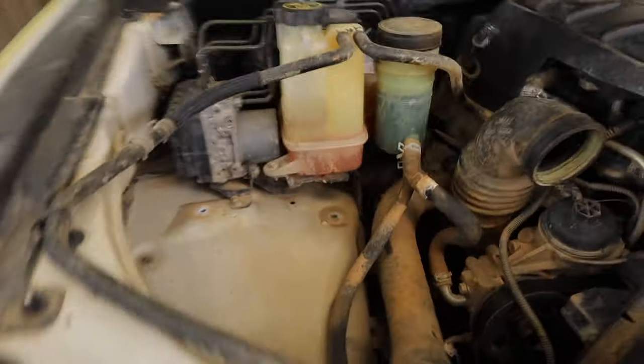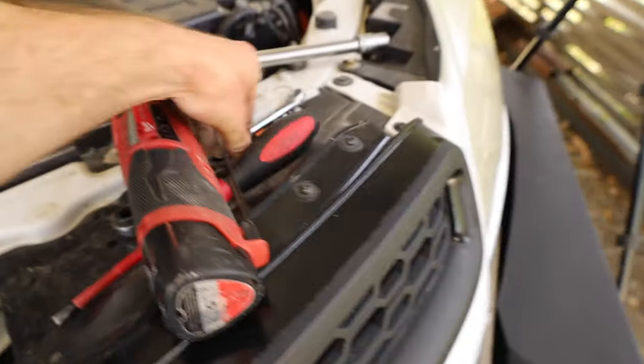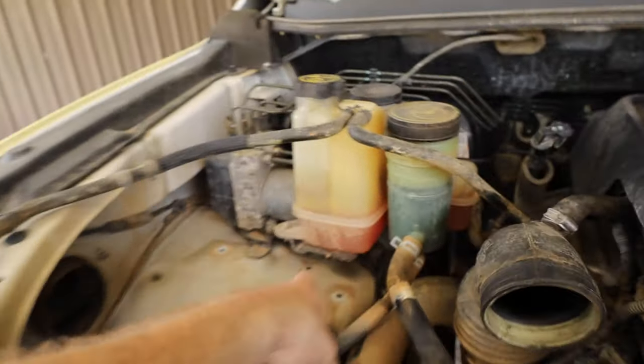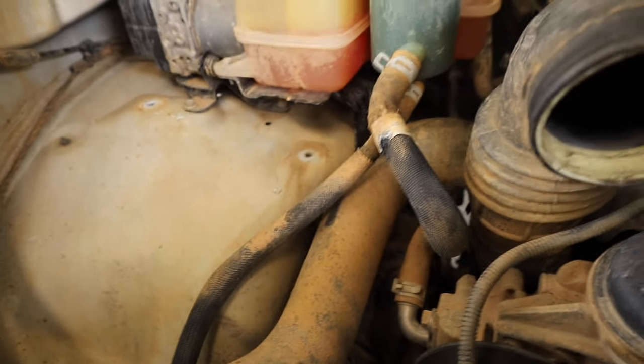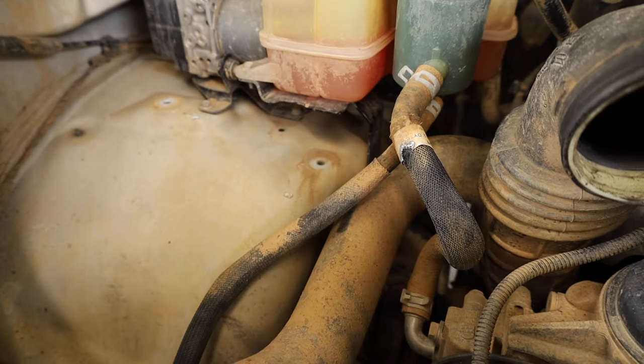Alright, well, if you're doing this at home, that bolt under there is a bit of a pain. Start with a ratchet and spanner and get as long as you can, but then it sort of hits the underside of the coolant holder there. So you have to get an open ender and just keep going. I was probably spending about 10 minutes just unscrewing that. The bolts are quite long, so you're going to be sitting there for a bit with your hand underneath the power steering lines. But yeah, you'll get that out.